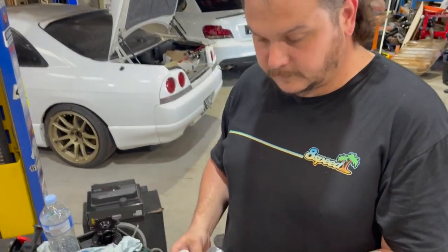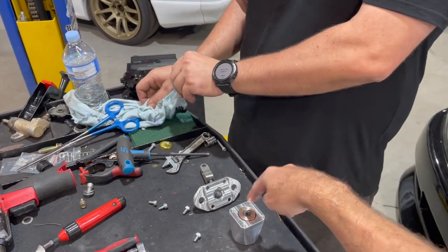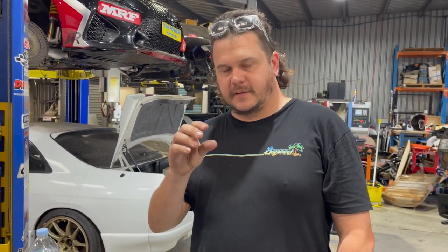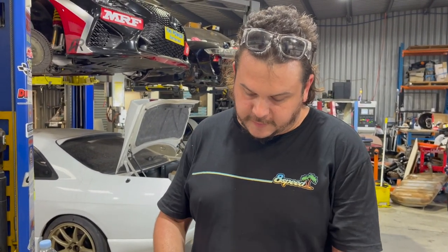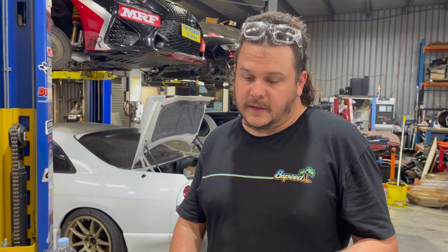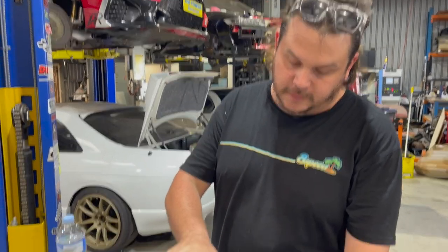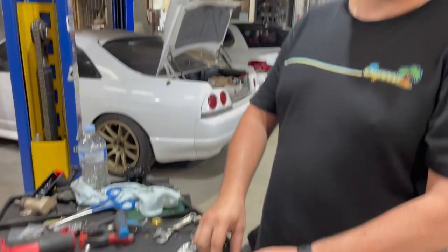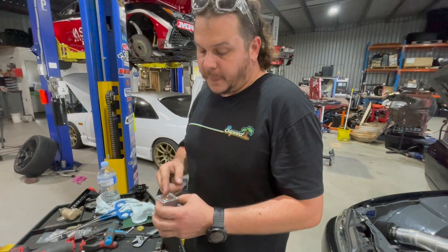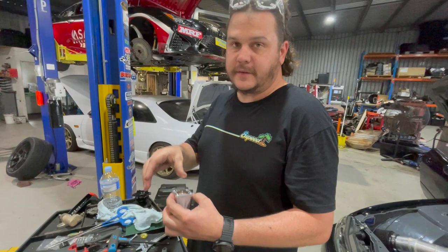Okay, so the big thing that you've really changed is the thing that pushes on the spring. Before, I think it was 6 or 8mm, basically just a disc with the profile in it for the end of the push rod. We did that on Brent's car, and what we found is after a while it wore a little bit and would twist a little bit and jam up in the bore. So with the JZ valve bucket in here, it's quite a bit longer, probably 15mm long, so it can't go sideways and jam up in the bore.